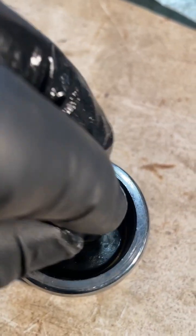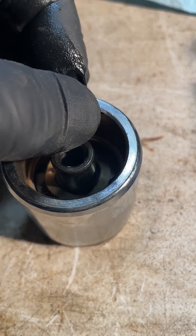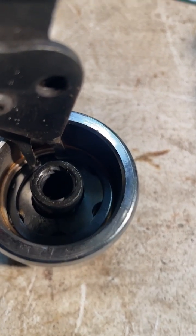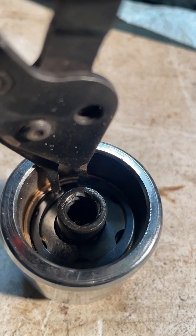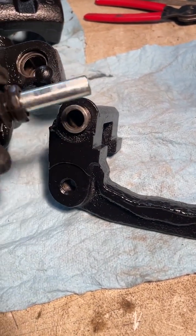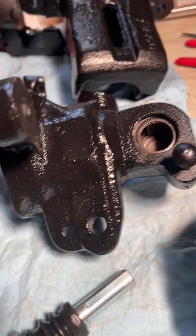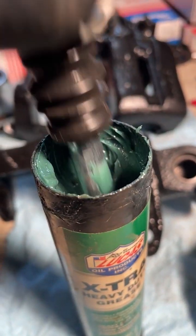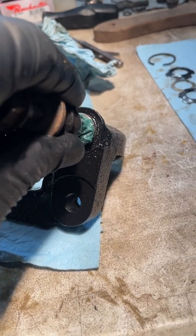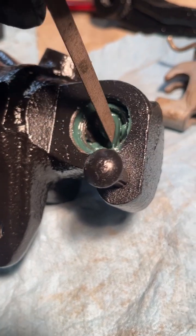This guy just goes in here, push it down. I'm going to need two hands to do this — what I'm going to do with the picks is push that back end in, squeeze these with the clip pliers, and just push it into the groove that it came out of. I'm just going to do the components that need some grease: the pins that go in here and the e-brake needle bearings. I've got some heavy duty grease — I'm going to scoop them up pretty good here, just get a bunch on there, and in they go.